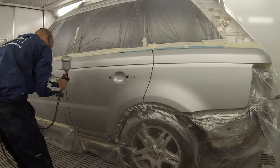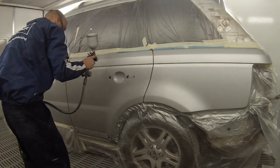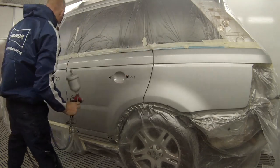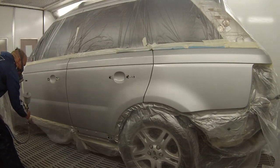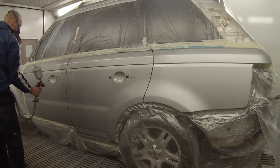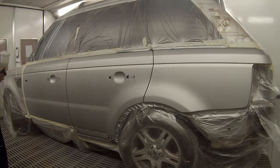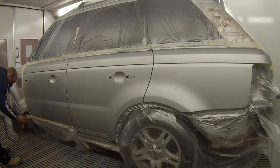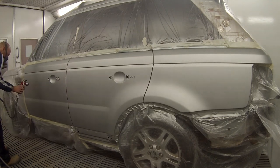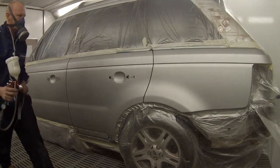I've also colour matched it. With the bumper bar I've left out most of the base coat footage but I've given you a look at the second coat of clear on it which you'll see soon. I've decided not to blend the colour over that bumper bar — you can see I'm blending the colour over this front door here. I'm not putting any up the front edge and also not putting any up the back edge of that quarter panel where it goes around to the tailgate. I try not to blend bumper bars because this one's actually been painted before and who's to say the last person didn't get their colour wrong. I like to put the colour over the whole bumper bar.